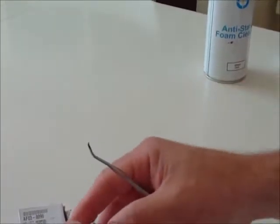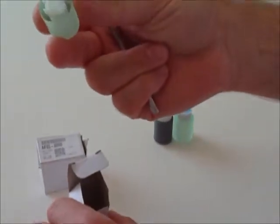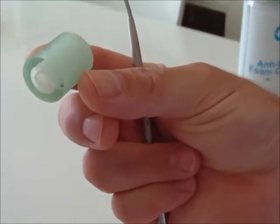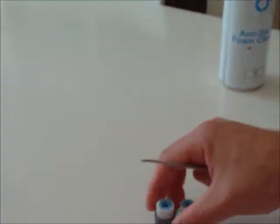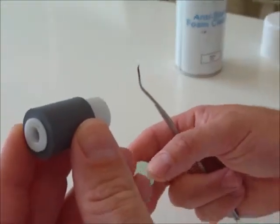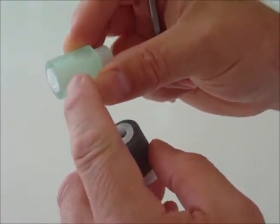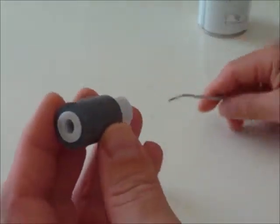However, the SEP tires are going to be short. As you notice, the couplings for the rear, where they get their drive, are slightly different. If you do put these in, you will have to put a shim on this side of it to make it fit properly and line up appropriately with the upper feed roller. But what we're going to do today is try and take the rubber off of the standard Kyocera and replace it with the Ricoh. Now, as you can see, the Ricoh is slightly bigger, but it's made of the high durability silicon tires that Kyocera has yet to adopt, and hopefully we'll start seeing in the near future.